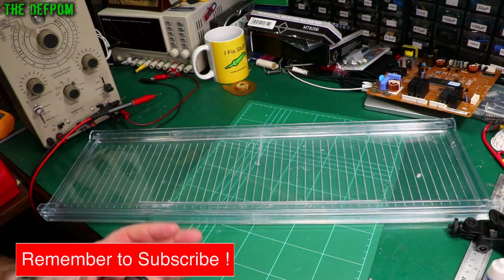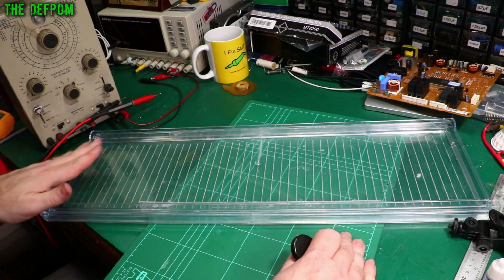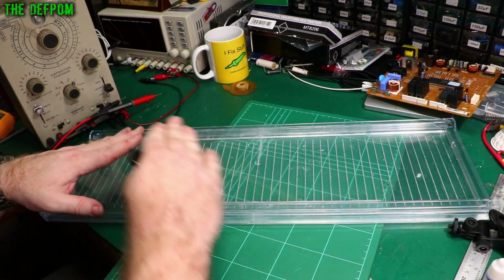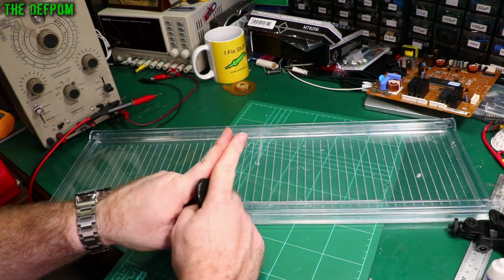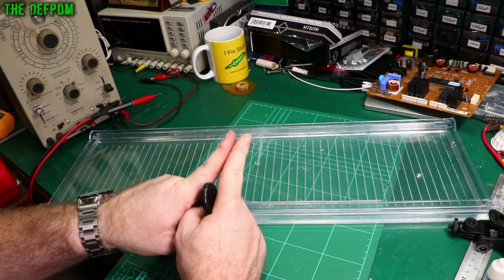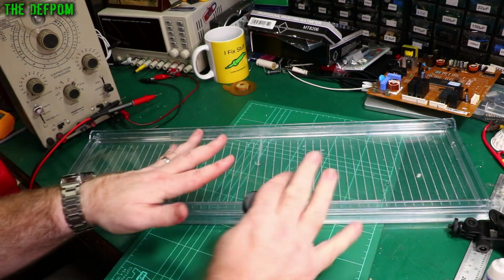So basically what I'm doing to fix this is I've super glued the cracks and held up one end of it to help bite it back, to hold the joints together, so the plastic that's fractured is still touching, right? You don't want a gap there, you want it touching for maximum strength. So I've done that. That stabilised it.